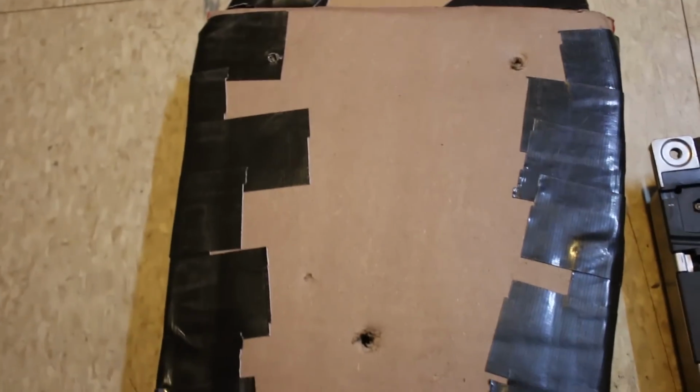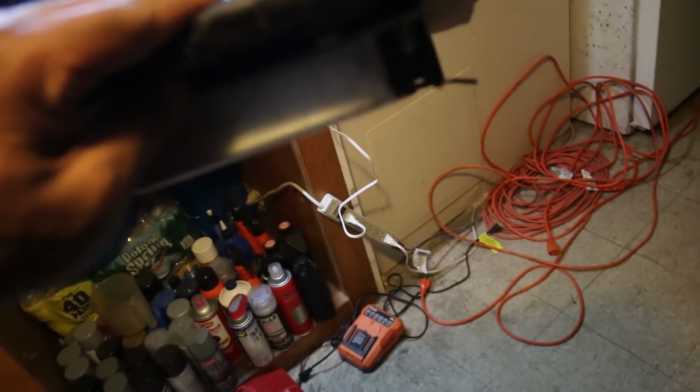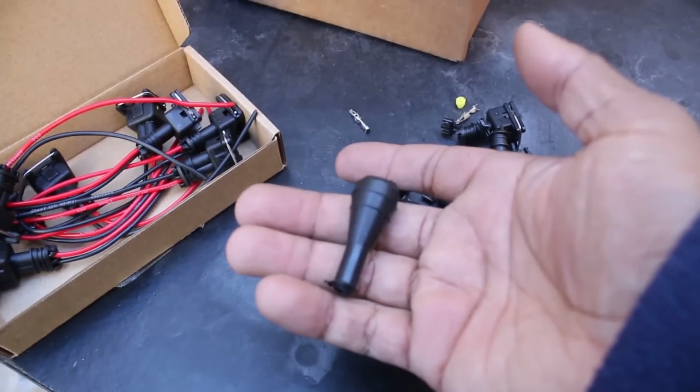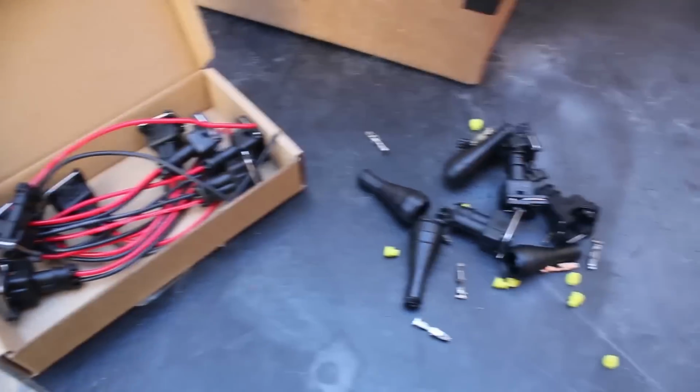The fuel injection harness generally resides entirely on the engine area, and also I didn't have to remove anything from it, only had to lengthen or shorten wires here and there, so it seemed like a fitting starting point. So I started with the fuel injector connections. I ordered these pre-wired ones for simplicity, but I also ordered these disassembled ones simply because I wanted the rubber shrouds that came with them.